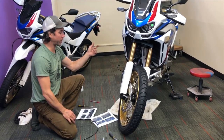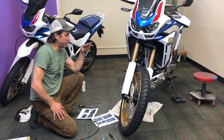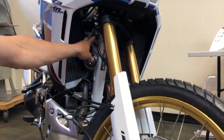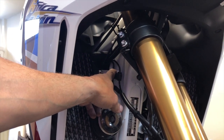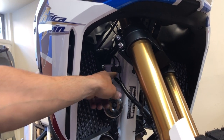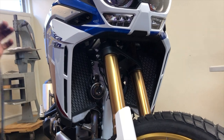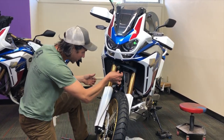Now I'm getting ready to do my brake line. The objective is to get everything prepped in place and ready to go. Once I'm all in place, I will then separate the hard line, which comes off the ABS block and then goes to the OEM soft line right here at the ABS block. I will open that compression fitting, which is an M10 — it's soft, so make sure you've got a good spanner wrench on there because it's soft to make a good mating surface. I'll have everything queued up and ready to go so I minimize the amount of time I've separated the line, minimizing brake fluid loss and introduction of air, which makes our bleeding job a little bit easier.